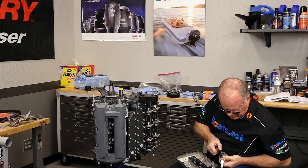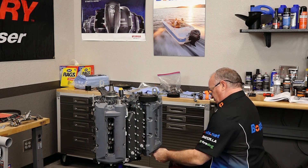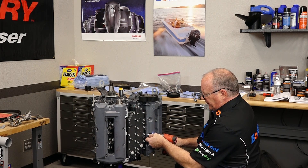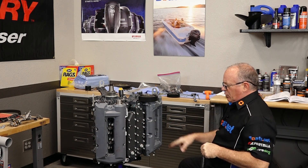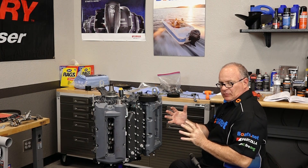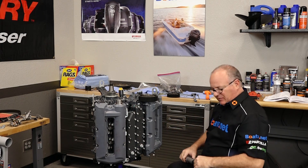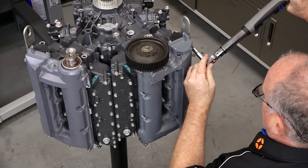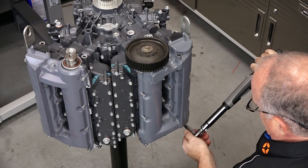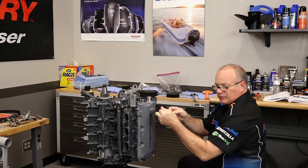I'm going to use this to run them down but this is not what I'm going to use to set the torque — I just want to get them in there easily. Then we'll get them torqued. Now what they want you to do here is go around and tighten them to 5.8 foot-pounds and then go back around, because there's so much rubber material to compress down it won't be even the first time around. The second time around we'll even everything up. Let's bring it around and do the same thing to this one.